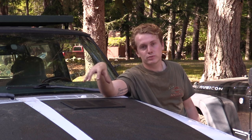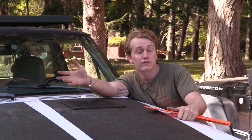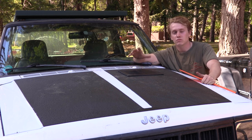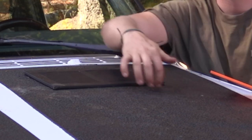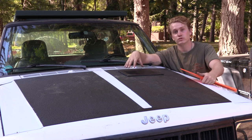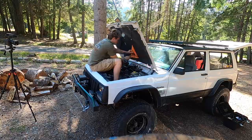Now, it would be more than possible to just simply drill the holes, cut out a section underneath this hood louver, and put this hood louver on the hood. Would it look as good? No. Would it function? Yes, it will function just the same. So I want to recess it under the hood so all you see are the vents, and it'll look closer to like it's supposed to be that way. It'll look better and have less risk of catching a log, branch, or wind. I'm going to start measuring up — I think about three and a half inches of gap. There's nothing really electronic right under there, so I'm not so worried about water getting in.